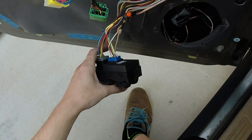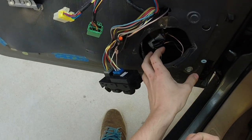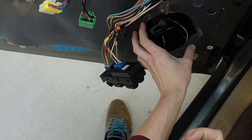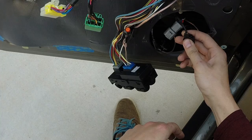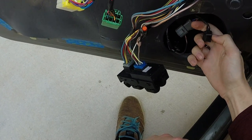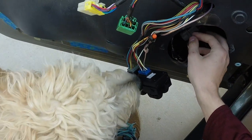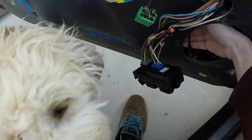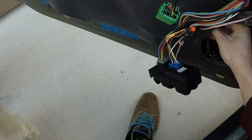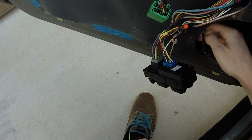What you're going to want to do is take off your entire door panel, then take off your speaker down here. You'll have a pigtail for the power to the speaker that's connected right here just by a clip. Pull that clip off, and back over here reach your hand in — there's going to be another clip connected to the motor for your regulator to move your power window up and down.